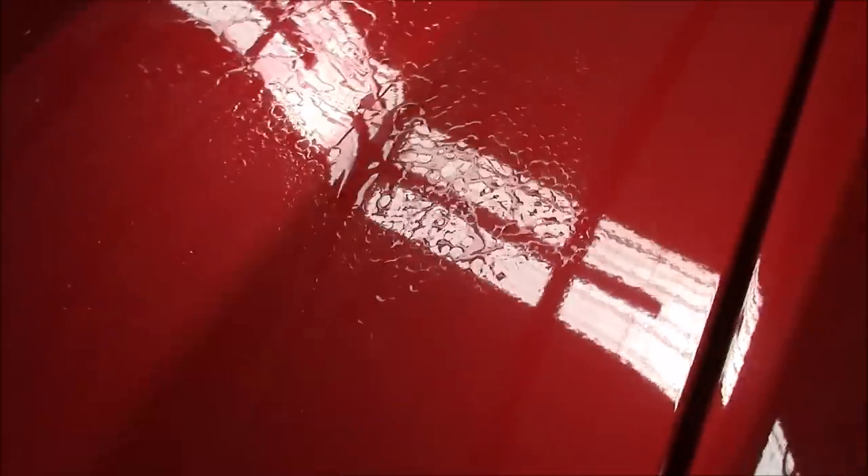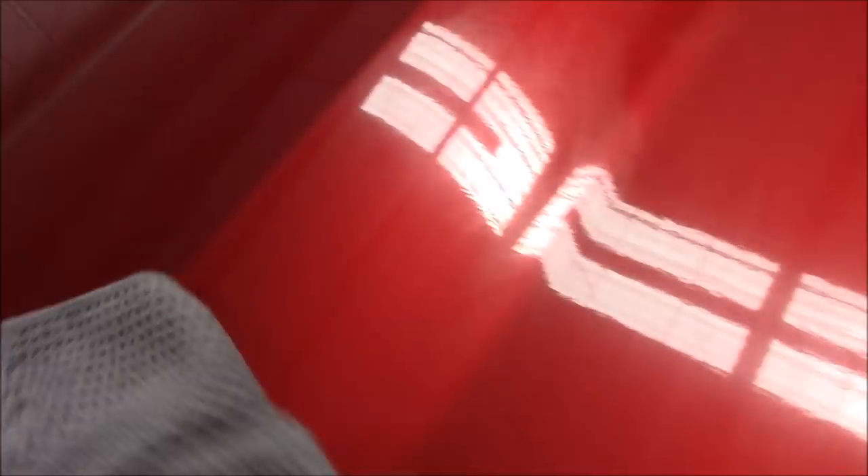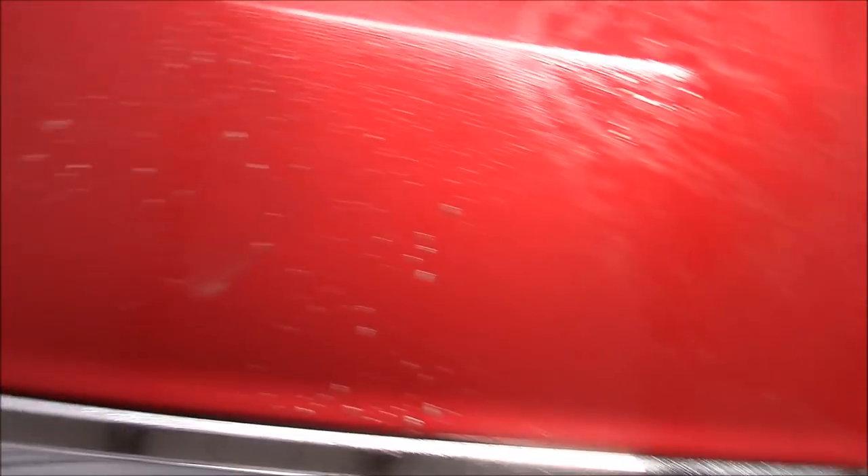I tried using the Infinite Use DetailJuice — what I have on this towel — and just give it a little wipe. I'm pulling contamination off but not the overspray. You can see it's nasty. It does an okay job but doesn't remove everything. So I'm going to step it up on the hood to using the Infinite Purpose Cleaner and see where we go from there. You can see all the contamination — all the dots. I'm going to spray it with the Infinite Purpose Cleaner and use that as the lube.